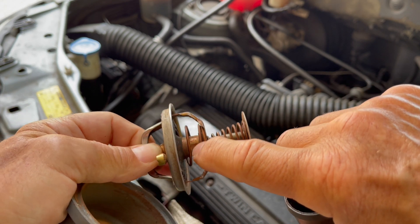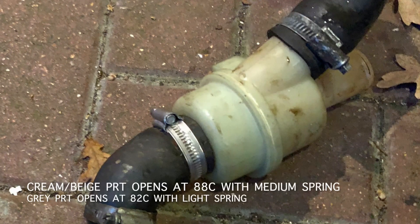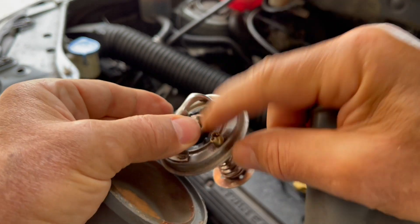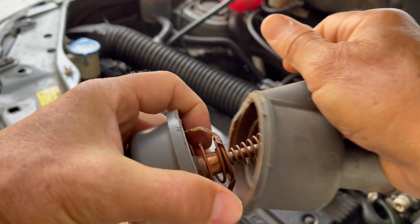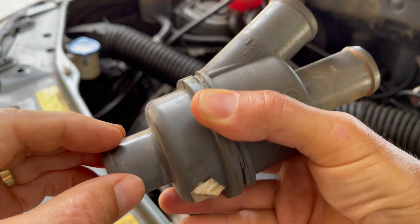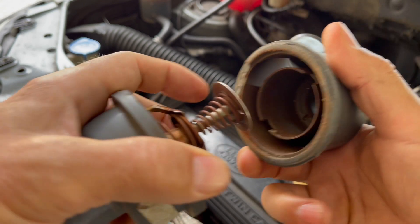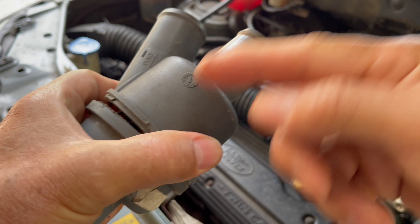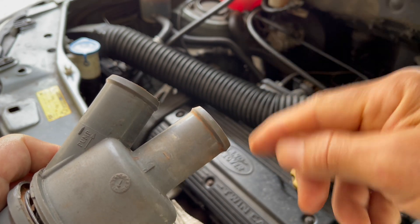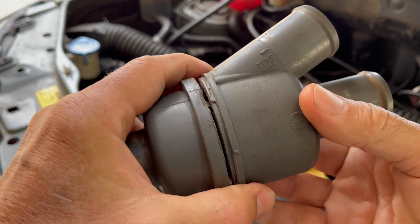This is the sensing part of the thermostat — it's a wax thermostat, and there are two sorts: something like 82 and 88 degrees centigrade, either a beige or a grey one. When the water is hot enough this plate opens and water is then allowed to come back from the lower part of the radiator, goes through into the engine off to the pump, and when this opens more pressure is applied on this plate which slows down the bypass flow. Further up there's a T-junction so the water from the engine also goes out to the top of the radiator, gets cooled, comes back and goes off to the pump — that's basically how the pressure release thermostat works.